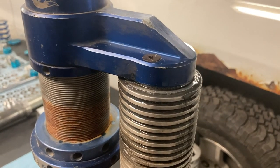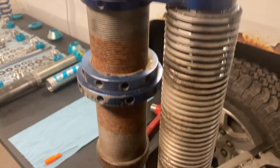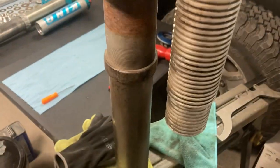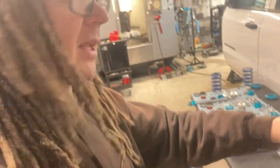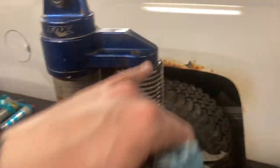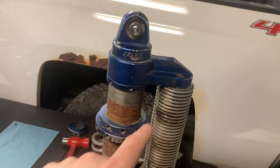If you are going to try to work on your own shocks, definitely don't put them in a press, press the seal head down, take the C-clip out, and then let the press up - because you kind of have a bomb. You've got to get the nitrogen out as safely as possible. If it's got a remote reservoir with a hose, you can crack those hoses the same way I did here with the Allen screws. Be careful because you're getting low on threads and if you have a lot of pressure, you can rip threads out pretty easily - a lot of this stuff is aluminum, so do at your own risk.